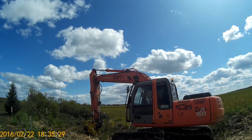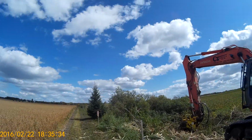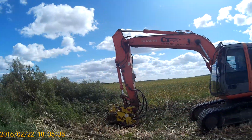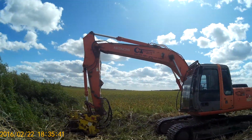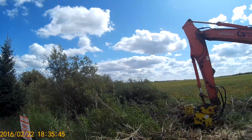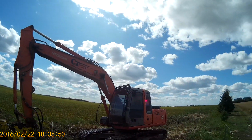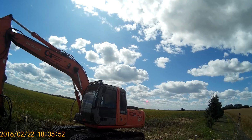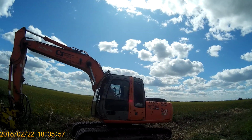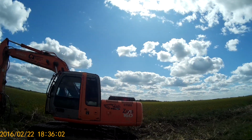The engine's getting a little more smoky, burns a little bit of oil. So, it won't be long and there'll be time for an engine overhaul or replacement, because I believe these engines don't have liners for the pistons, or sleeves, whatever you want to call them. It'd be kind of a shame to get rid of it because it doesn't have DEF, it doesn't have a diesel particulate filter, no EGR. It runs the way a diesel engine is supposed to run, unhindered.